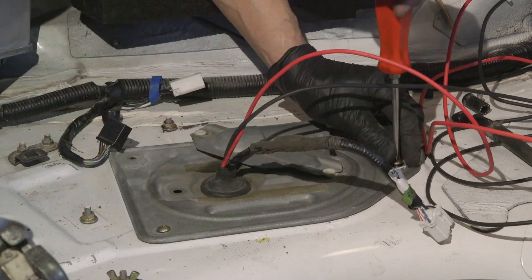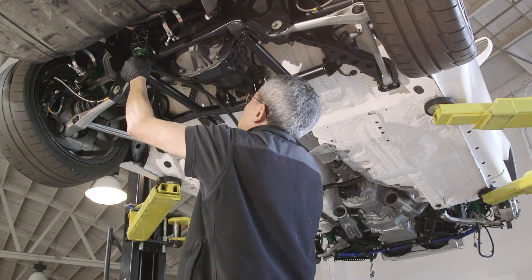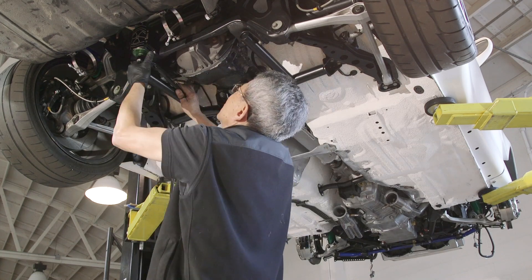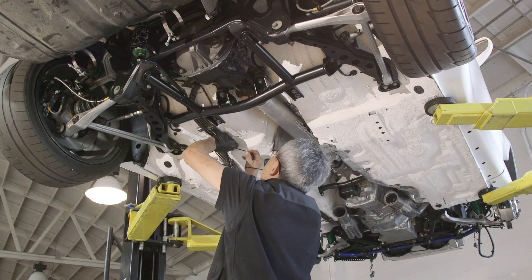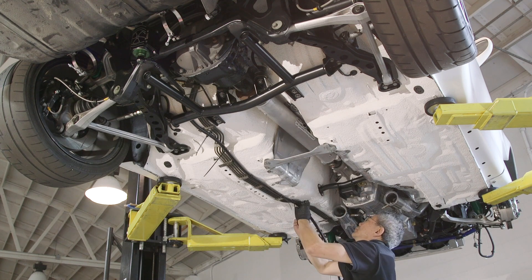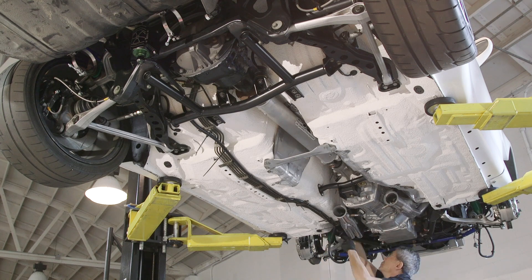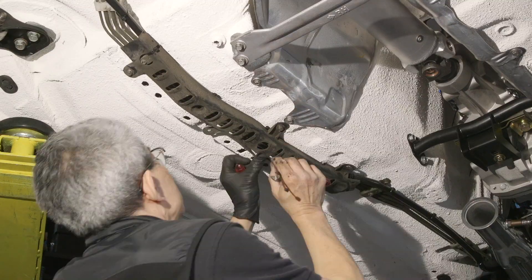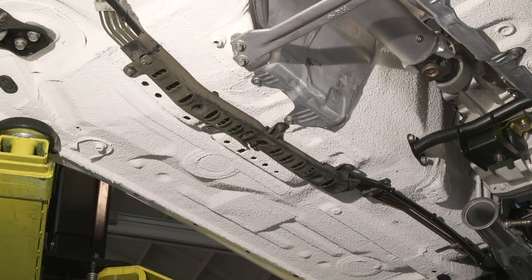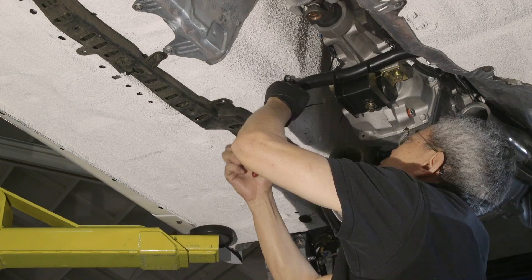The car's interior can all be reinstalled. Now our larger fuel line can be routed from the fuel filter up to the engine compartment and fuel rail. We ran our line along the OEM route — we removed the factory protective covers and zip-tied the new line to the factory hard line, then reinstalled the covers over the new fuel line. Now we have a state-of-the-art fuel system in our FD RX7.